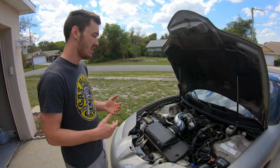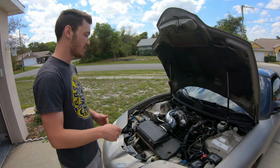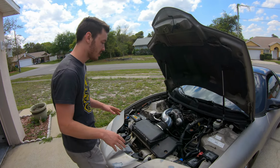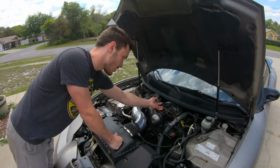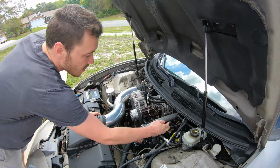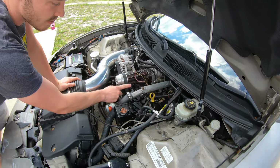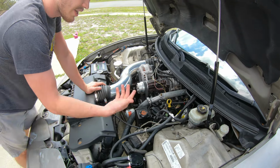And then the other part is you're gonna have to mess with your wiring harness. I'm looking into the whole de-looming and just redoing everything. But what I ended up having to do is there are points where I had to cut and add wire distance for the mass airflow. And then for the ignition coil module, I remounted it from the back up here to the front of the head like a front wheel drive car. I had to add some wiring there.